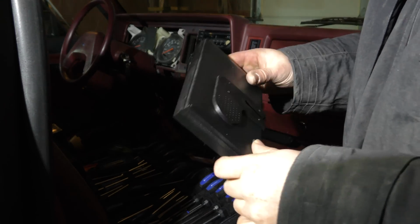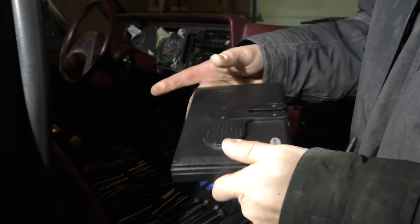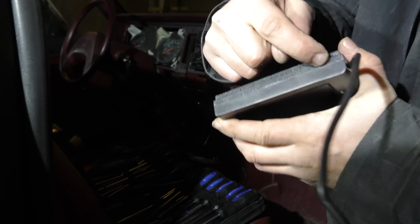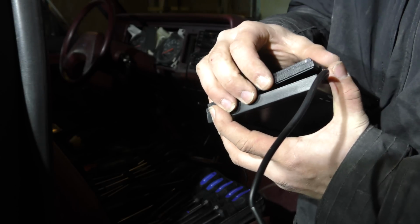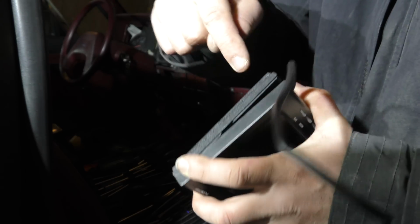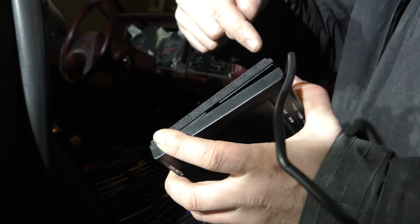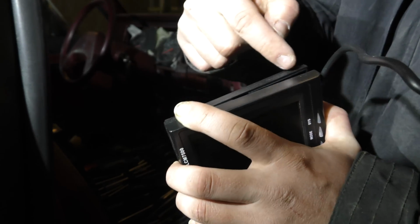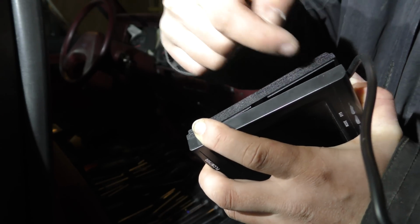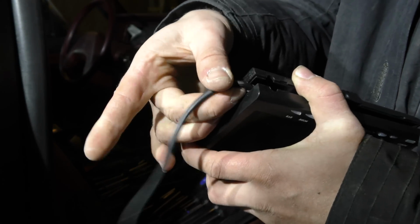Okay folks, so I got the monitor out, and I got the back screws taken off here. It looks like this is going to be a relatively simple job. We're just going to drill a hole, however big this hole is, right on here. And if you look, it's pretty much just empty space here. So as opposed to the wiring coming out the bottom, I'm going to have it come out this side. So we'll just make sure we miss the screw hole here. Drill up in here somewhere. And like I said, just drill the same size hole.